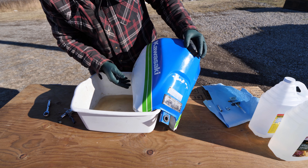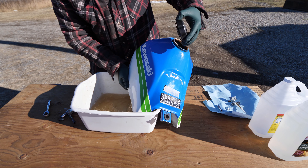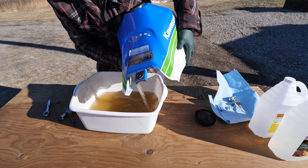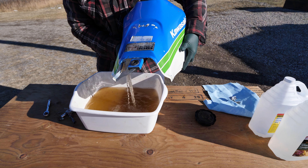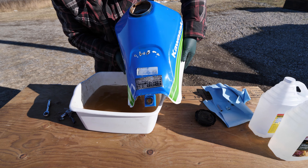I pretty much had to mute the audio because we were having 70 km/h gusts that were unbearable to listen to. I continued to flush with vinegar followed by gasoline and the liquid ran clear. You are going to want to do these steps back to back without letting the tank dry — allowing the inside of the tank to dry can cause flash rust to develop.